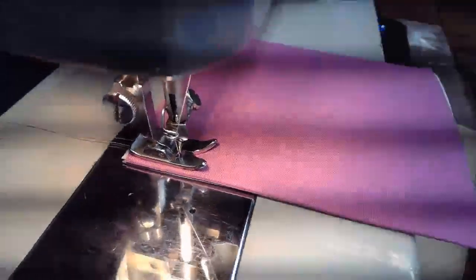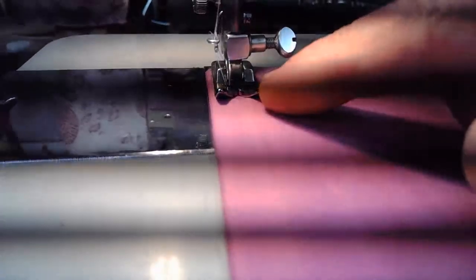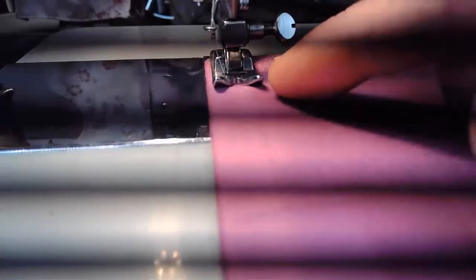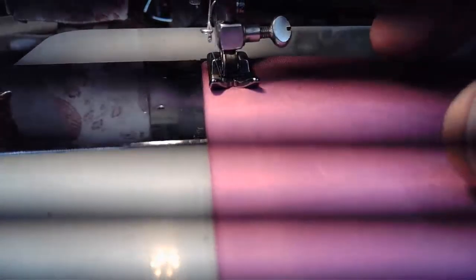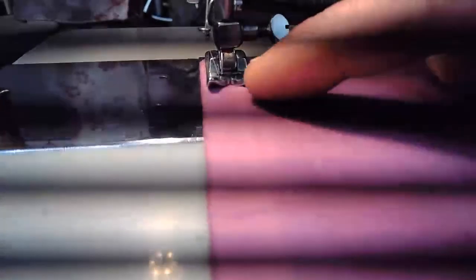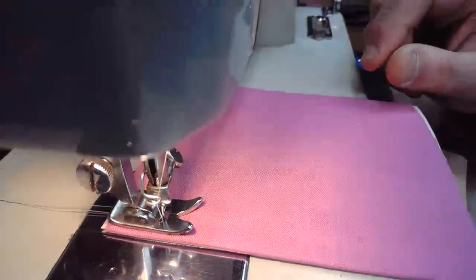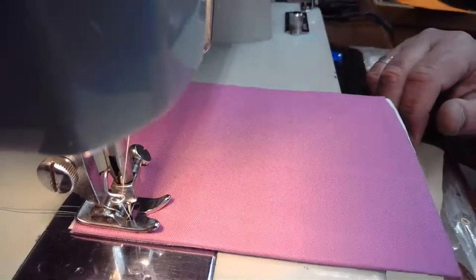And if you didn't notice it in the shot, let me show you one other thing. This was classic of the Japanese machines. It does not have the capability of giving you a genuine center needle position. The needle on a lot of these Japanese machines is always going to be offset to the left. And they did that for seam purposes. Many of you that are much more gifted and knowledgeable sewers than I am would be able to explain the huge benefits of why the Japanese set it up with a left needle position as the most common setup on the machine. You can share that in the chat and let other people have an even deeper understanding of the brilliant design of why they would do something like that.